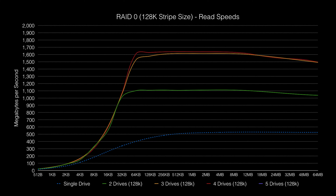So let's add a fourth drive. It's a little faster — 1,640 megabytes — but why such a small gain? Is it some sort of diminishing return of RAID 0? No. Remember the DMI 2.0 bottleneck I mentioned earlier? We just hit it. Adding a fifth drive tells the same story: no more gains. If your processor uses DMI 2.0 for communication with your chipset, there is no performance benefit running more than three drives in a RAID 0 set.